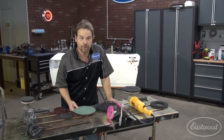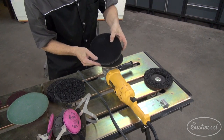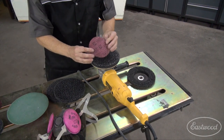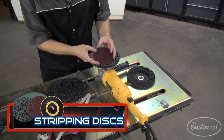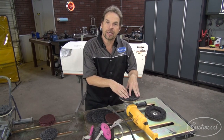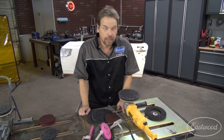Eastwood has got something way better - check this out. These are stripping discs, and they come in a variety of different sizes and different grits. They utilize a super strong hook and loop fastener - better known as Velcro. There's a huge footprint, a couple of different styles, and different sizes, as well as grits that can finely polish the metal and take the paint off without profiling, without digging giant holes in it. The other benefit to a porous type stripping disc like this over top of 40-grit or 36-grit paper is it stays cool. It doesn't build up a lot of heat on your panel, so if you've got a late model car or a thin or large piece of metal, this isn't going to heat the panel up and it's not going to warp it. You just got to get in there and take the paint off.